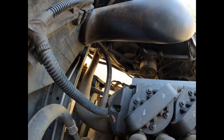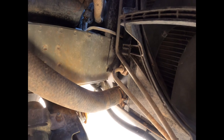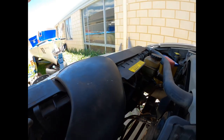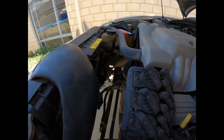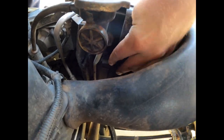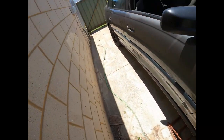To get at them you're gonna have to remove these covers, the air duct, and get the fans out because these bolts aren't accessible with just a normal open-ended spanner. I had some sort of offset spanner — might be able to do the job open-ended. So we're taking the fans out, removing the power steering fluid. I've got it on stands and chocked.